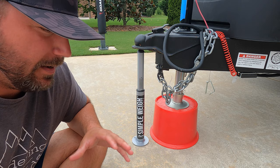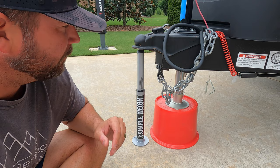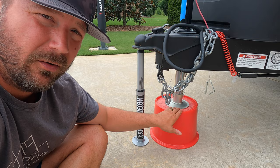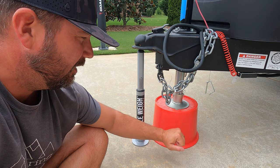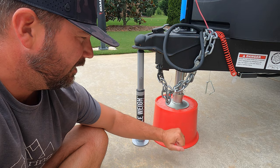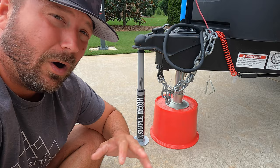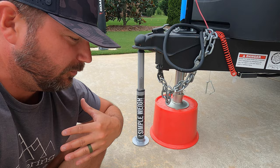All right, let's jump right in. There's only three rules for today's video. One: make sure your trailer is well chocked and all your stabilizers are up. That may seem obvious, but for some they need a reminder. Two: as soon as this leaves this platform, I'm done. I don't need my foot here on the tongue jack to be any more than one inch off the ground. I'm going to try to keep it less than that. As soon as it comes off of this little Anderson hitch block right here, that's it — I'm stopping right then. Because this is not terribly stable; you can see the footprint on this thing is not that big. So I want a little safety net right here.